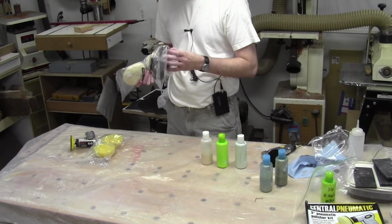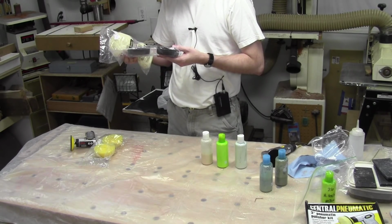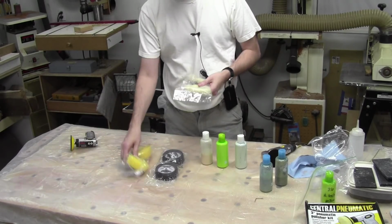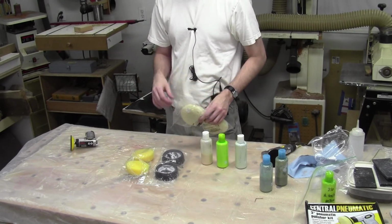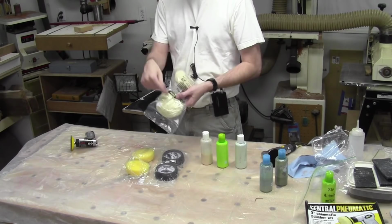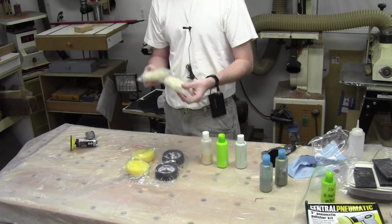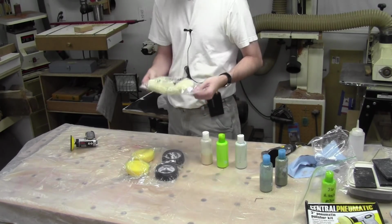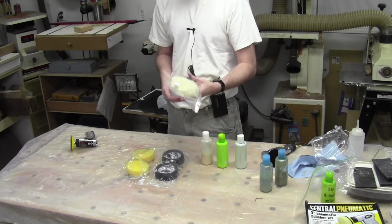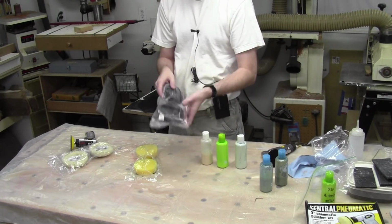There are different densities that do the job here. So yeah, I'm going to start. It's weird to me, when I think of polishing, or waxing a car, these foam or wool buffs are the things I think of as the final make-it-super-shiny step, but it turns out it's the first step. It's the cutting step. They're called cutting pads for heavy compounding or for getting all the scratches out. Then you move into these foam pads with different compounds to get a final polish.